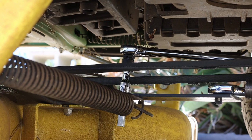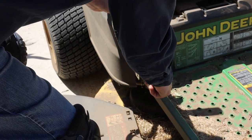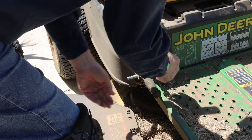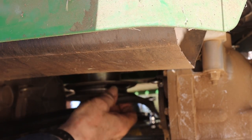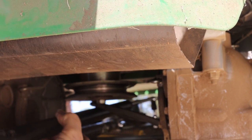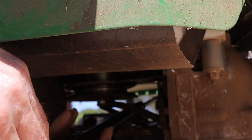This is the tool installed in the 3/8-inch hole on the lawn tractor — pretty tight working area. Lower the deck to the ground. The idler pulley is locked, so there is no rotating and slipping the belt over possible. We can now use our two ratchets and cheater bars to release tension enough to slip the belt on — no clamps and wood blocks necessary.